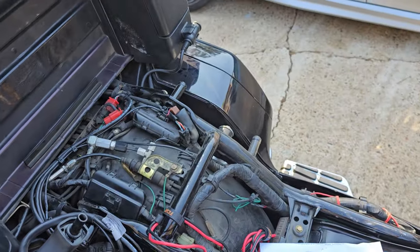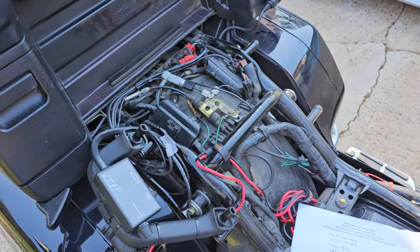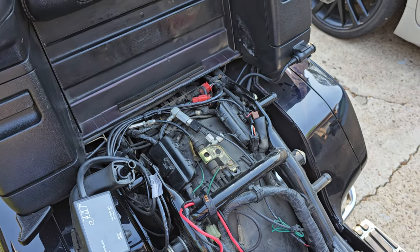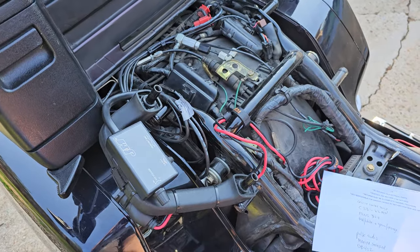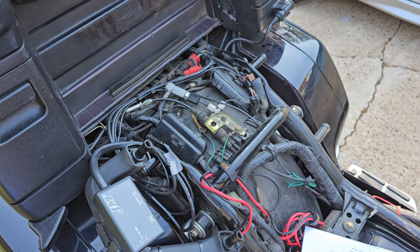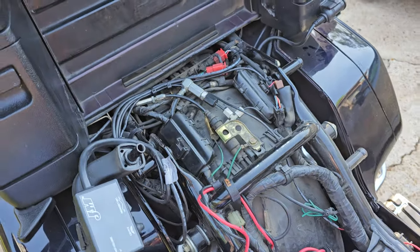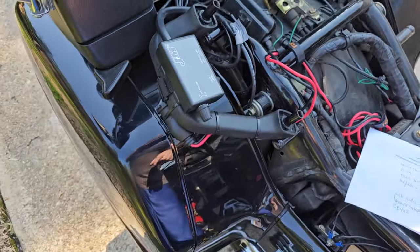Swap the red/white wire and green/orange wire positions, put them back, put the plug back, put everything back - and that tricks the module somehow so that now you can run the cruise control over 80 miles an hour. I tested this - I was setting the cruise control at 90 miles an hour and it worked perfect. I believe this mod works on the '93 and up model, or perhaps '95 and up. Mine's a '97 so it worked perfectly. I'm so happy about that.